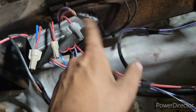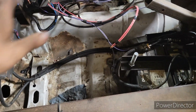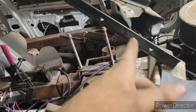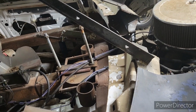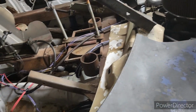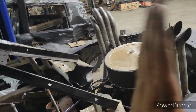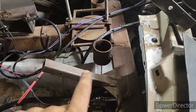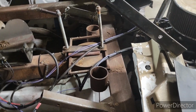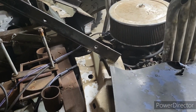The other one is ignition here, so I don't know if I said that, but it does run drive. I had the tranny crossmember flipped upside down, so it kicked it forward to put it underneath the pan of the transmission because I wanted it to slide and not accidentally lock in. But when I was driving, the engine would rock back and forth because I wasn't able to get the bolts tight, and it was also denting the tranny pan, so I ended up flipping it the other way, putting shorter bolts, so it's a lot more solid now.